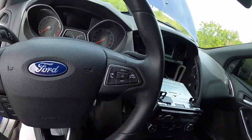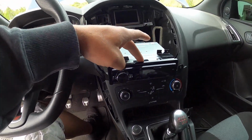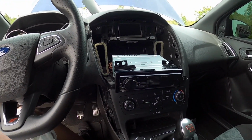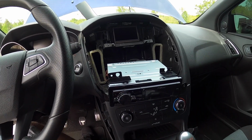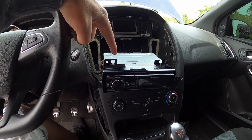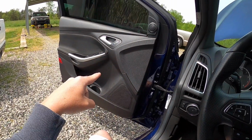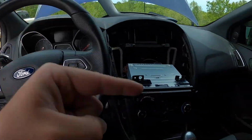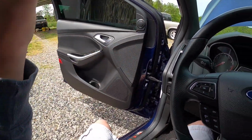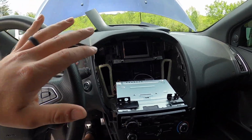But the mistake I was making is the ADPRS has the standard mode and network mode. I had originally pulled it out of the box and immediately put it in network mode and have been running the network mode, but I did not realize that enabled its active crossovers to interfere with the passive crossovers with the component set. So basically everything that this thing was telling it to do, the signal was not clean. It wasn't anywhere near where it was supposed to be crossed over at.